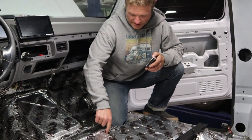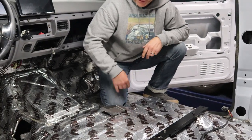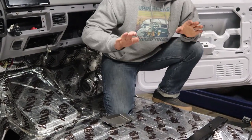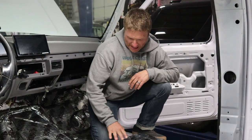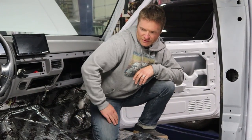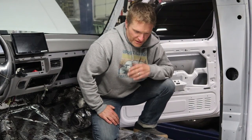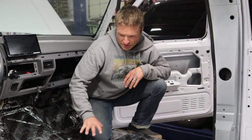So you just make a little rectangle cutout on your floor, install that guy, rivet it in, seam sealer, there you go. What that does is allow the truss for the passenger side seat to get as low as possible to match the driver side seat. And the rear was pretty easy — it was already as low as it can be. This was our biggest hurdle.